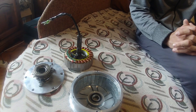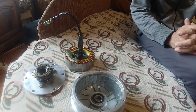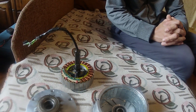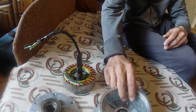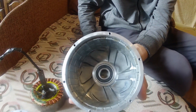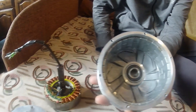This is the hoverboard motor enhanced for better torque and performance. What we did: we enhanced the magnetic field by adding 60 magnets — previously it was 30.